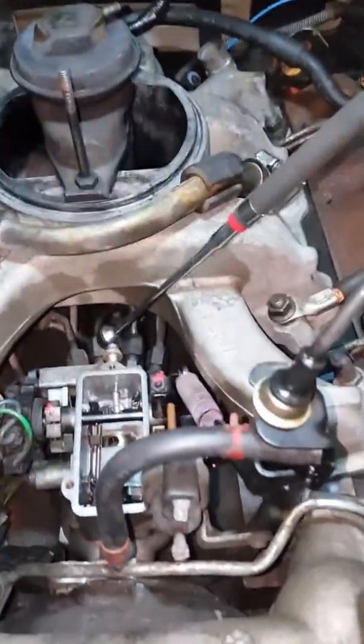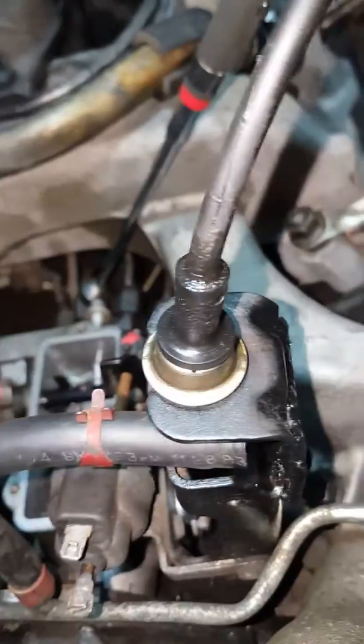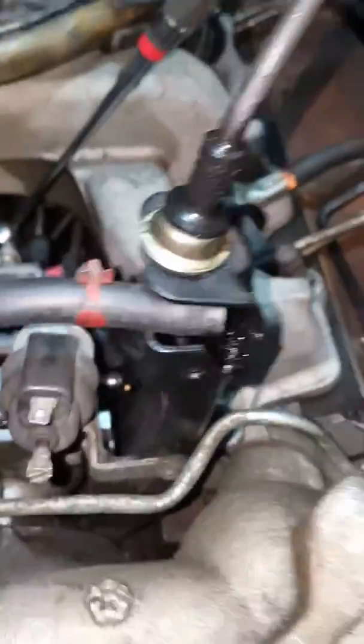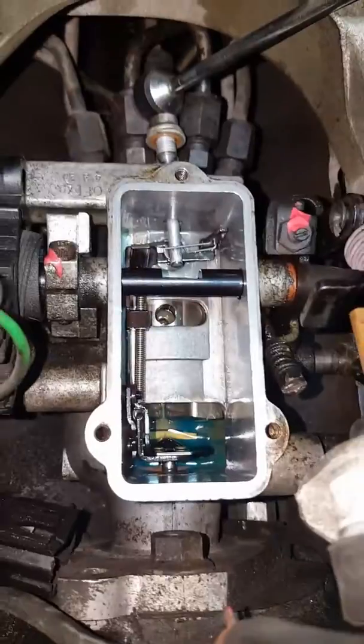So prior to this assembly, you take the air filter cover, the air filter housing off, and then all I did was, if you can look here, I took this, the return line for the fuel. And I took the linkage, and you see the fast idle, the high idle. I just loosened up the bolts on this side and slid it over. You see the bolts down there, there's 2 bolts. I loosened it up and just cocked it over a few degrees so I can get to the screws.